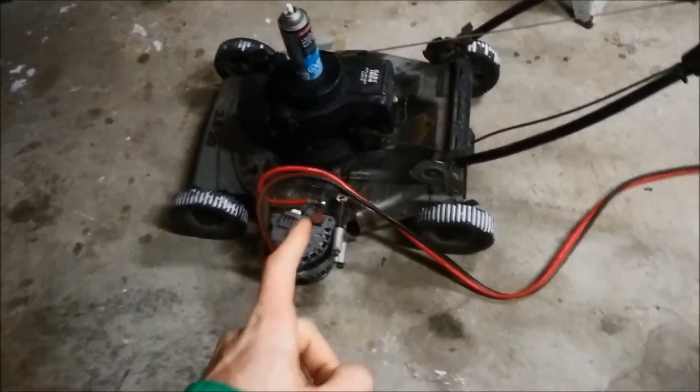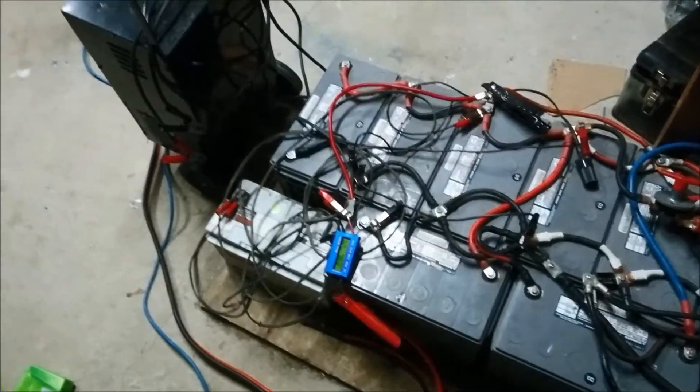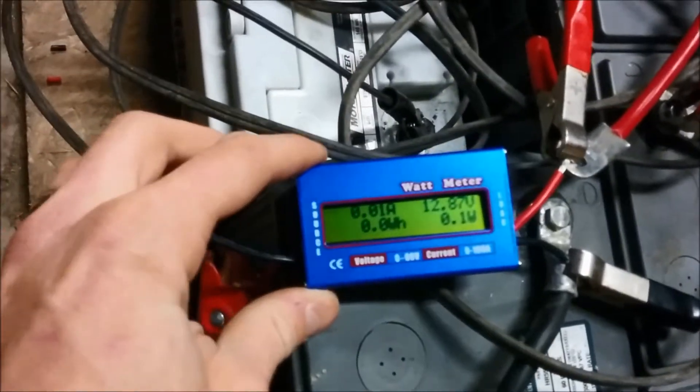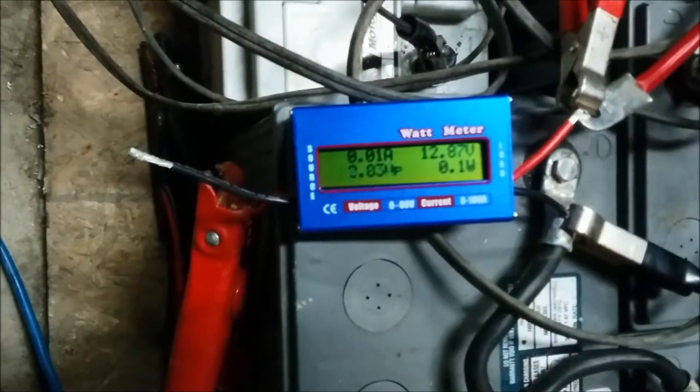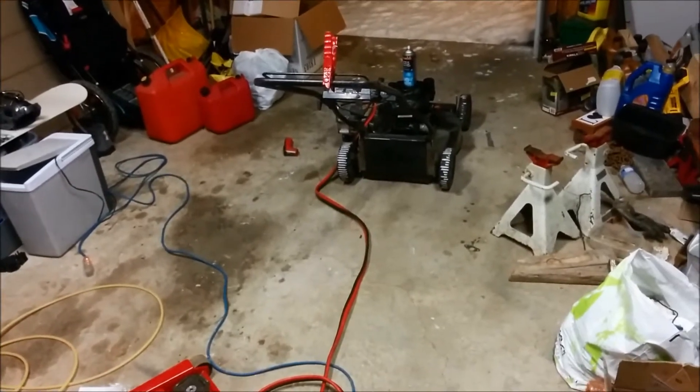Back to what I'm making this video about. I'm going to cold start this — my batteries have been just sitting, not being charged, and they are at 12.8 volts. So for the first 10 to 20 seconds, they will be taking the full output current of this lawnmower generator, and after that they'll start going down. This is also slightly a review of this cheap watt meter from Amazon. I have it going through the lawnmower generator, which runs over here through these booster cables into the lawnmower.